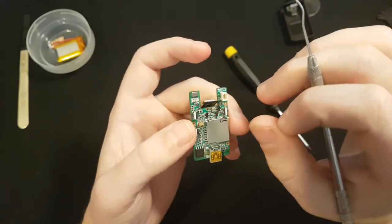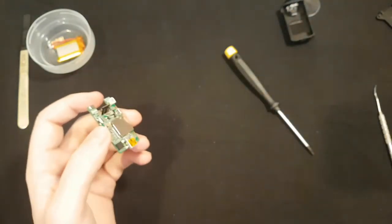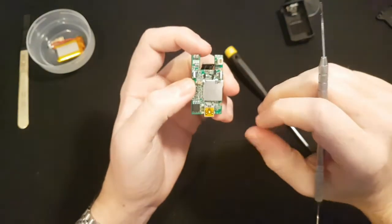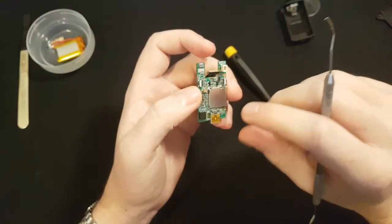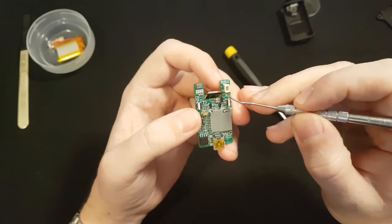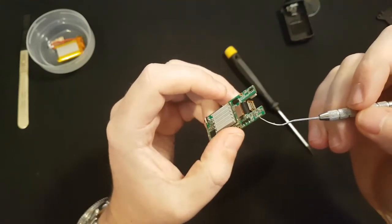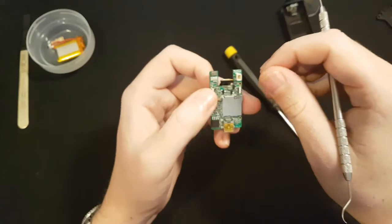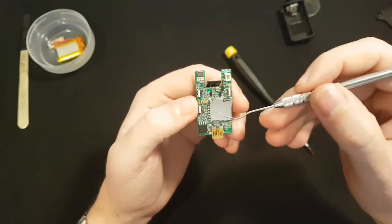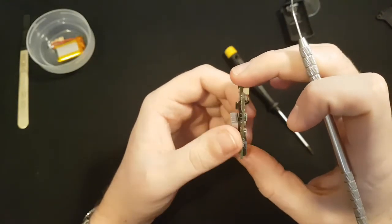The double-sided tape they use isn't so much tape — it actually has a little bit of thickness to it. It's almost like a Play-Doh-like sort of tape and it's not aggressively adhesive. So what you really need to do is find a way to grab the board there, or even try and put a little bit of dental floss around the board to get it in behind and then just gently apply pressure. Because it's not aggressively adhesive, it will actually just slowly release and pull up.